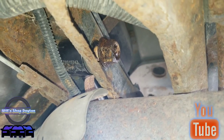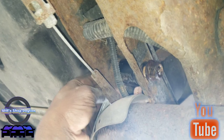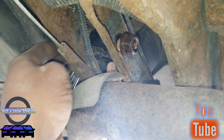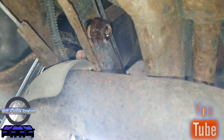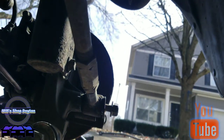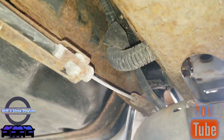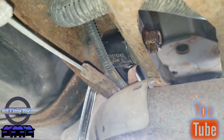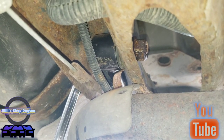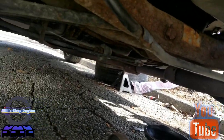Now we're back up under — we still have the subframe loose. We're gonna take a 21 millimeter on the back side there and take a 21 millimeter ratchet and tighten that down, then go down here and tighten up that and that, then put the subframe back. I'm probably gonna put the subframe back as soon as I tighten up this end. Sorry I can't get you good video because I'm up under the car and the mount is just too tall.